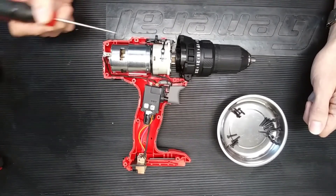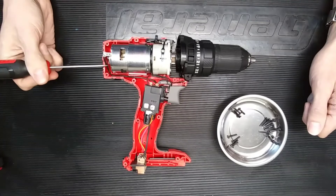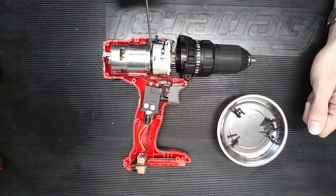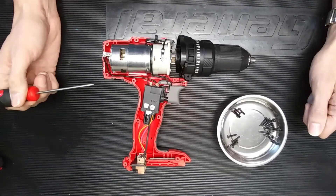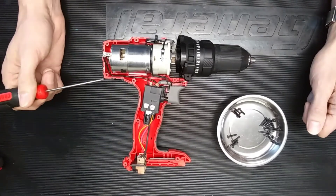As far as cooling — there's a centrifugal fan. These are the exhaust outlets here on the side. Intake comes in from the back side of the tool through four little holes back here, and then there's a corresponding set of holes kind of between these two pieces. The air flows in from the front and the back and exhausts out the side — pretty normal. I like that they have ribbed features around the exhaust outlets to direct the exhaust out of the tool instead of back into it. That's nice and efficient.